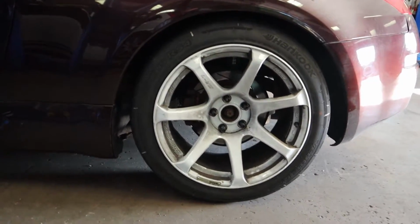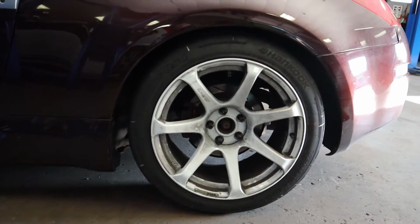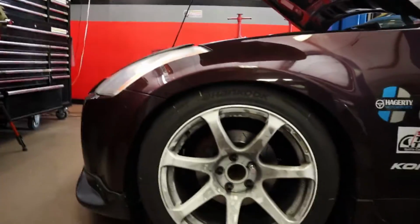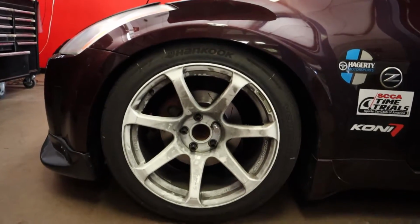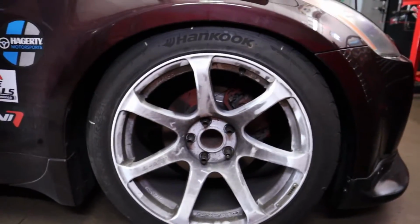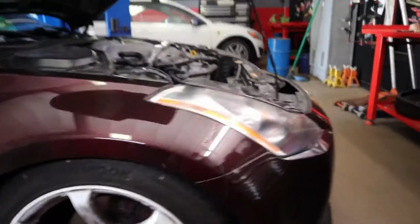Hey guys, so I didn't change the rears because they're actually like 0.6, 0.7 inches from stock, so I kept it like this. This looks fine for me. The fronts, however, were an inch or like 32 millimeters too high. So I dropped it there. Looks good on that side. And on this side, it's a little lower, I think.